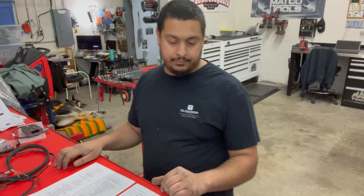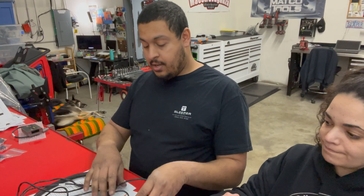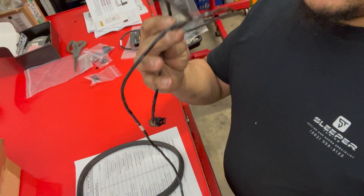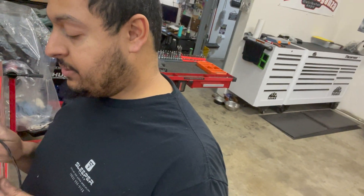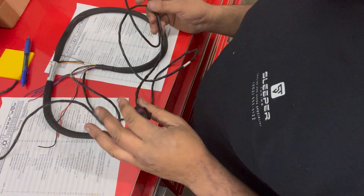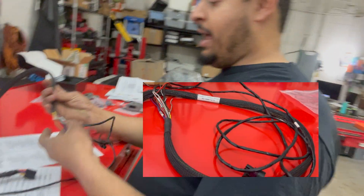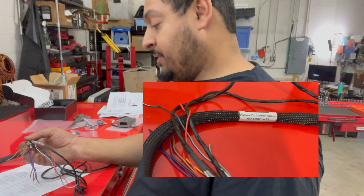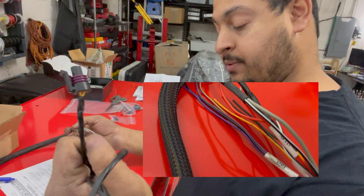I mean, it's just second nature with all of this, but this was somebody's previous work. This is the previous... It's very easy for electrical tape to get cut through or start falling off because the stickiness goes away. So not very ideal. Ideally you want to loom the harness. This is the Haltech Platinum Pro plugin auxiliary harness — they probably got the first two feet loomed for you, but everything after that is flying lead and you're supposed to wire it up yourself. This was just a poor quality attempt at wiring up the manifold pressure sensor and speed signal — just horrible.